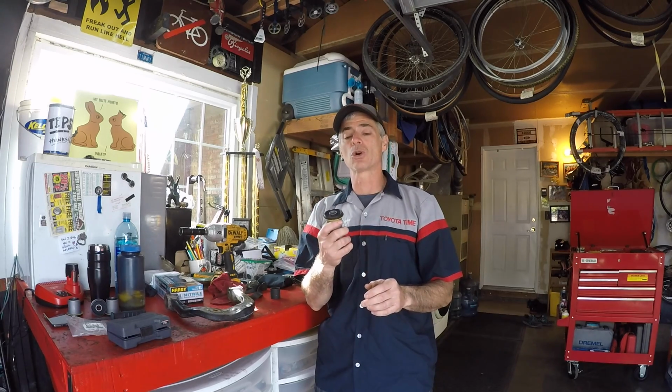For the upper control arm bushings, there are aftermarket choices, but from what I've seen, there isn't anything that I've heard that is a better choice than OEM. For the lower control arm bushings, Whiteline is a pretty good choice, and a lot of people have gone that route, including myself. But for the upper control arms, I would suggest going OEM, and that's what Jordan did.